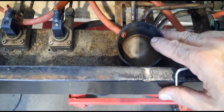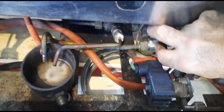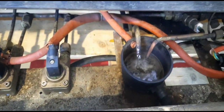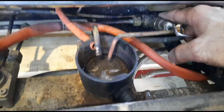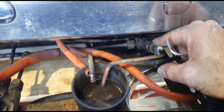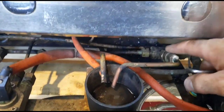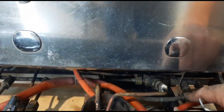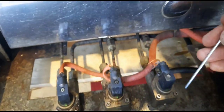Along here is the main drain. There's actually a tap that you can use to drain the boiler — and yes it does open, that will drain the water from the boiler. Not all machines have that. That one there is an expansion valve — if there's too much pressure in the system, that expansion valve will start dripping. Usually it just starts leaking over time, but if there is too much pressure in the system it will release water through there.